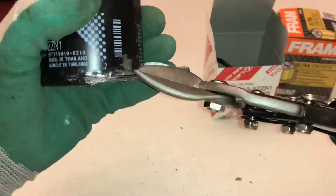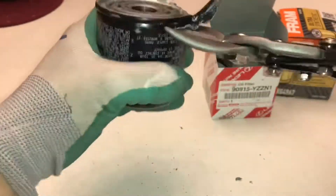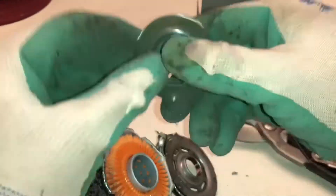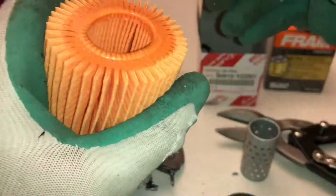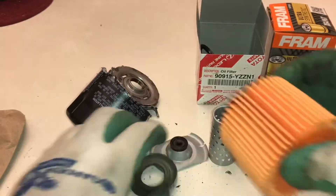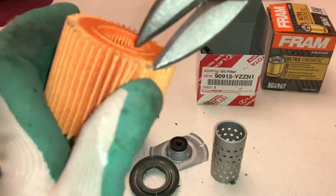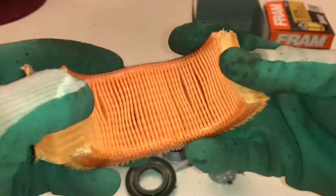I just wanted to dig into this myself and look at the paper material. Here we're cracking this open — there's the anti-drain back valve, not sure if that's silicone or rubber, and there's the cone, and then the paper material. You can see how the resin only goes about halfway through the top and the bottom. That's basically what people are saying is the reason why Toyotas are only 50% efficient at 20 microns — because the oil can go through the outer folds where the paper folds on the outer edge, since there's no visible resin there, creating an opportunity for unfiltered oil to pass through.